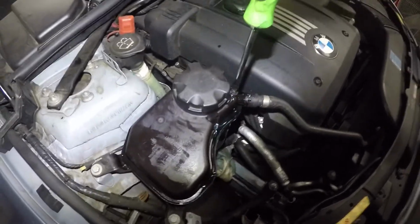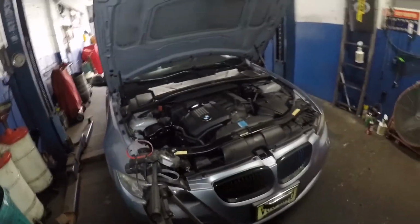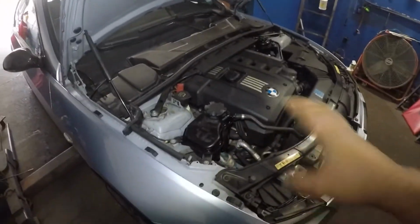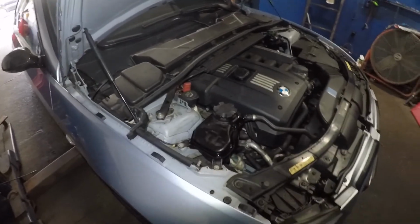No air, okay? And if I was you, I would do this bleeding twice, okay? Give it some time. Pay attention. If the car does not overheat, bleed again. And you should be in good hands, okay?